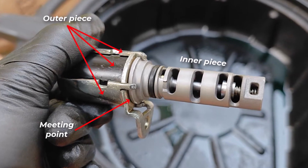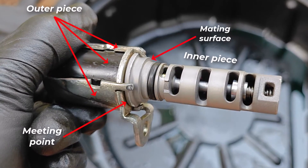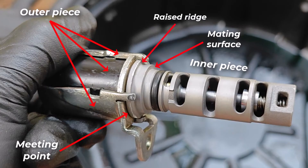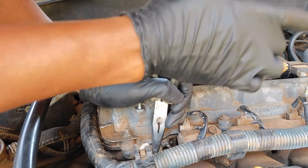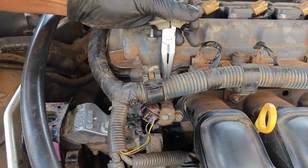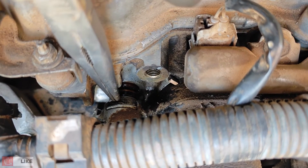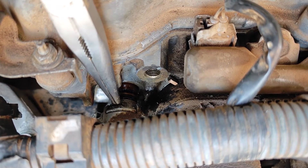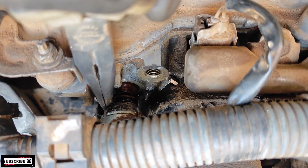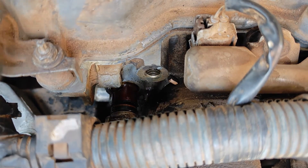Here's the magic bullet that removed this solenoid from the engine in one piece. If you look closely at the solenoid, the mating surface with the engine gives us a raised circumferential ridge to which you can apply some leverage. Wedging a long needle nose plier against this ridge and using some gentle taps on the handle of the plier, the solenoid began to come out. You can vary where you're applying the leverage on this raised ridge to ensure that the force on the solenoid remains perpendicular to the engine.